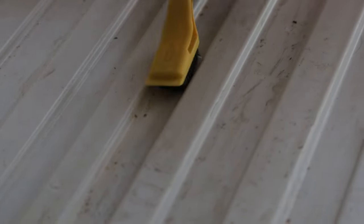Before we start putting insulation and subfloor down, there are just a couple of little rust spots on the floor. We're going to scrape those off with a wire brush and then paint over them with some white Rust-Oleum paint so the rust doesn't come back.